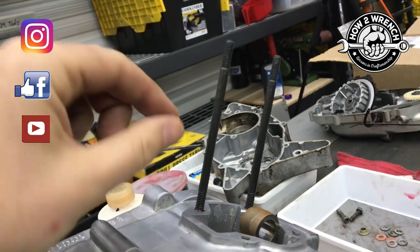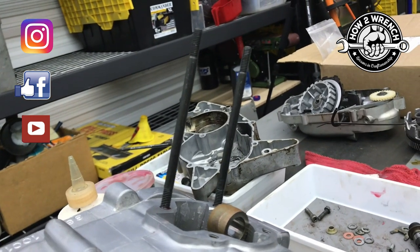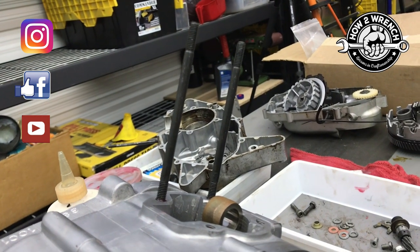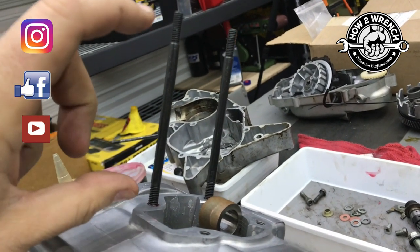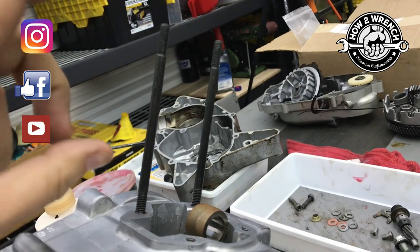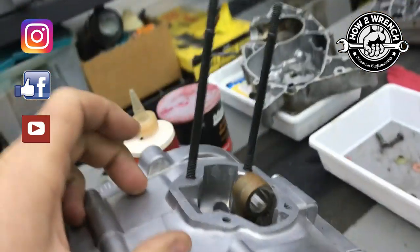When we look at the actual engine and see how long that thin bolt is — and if this thing has had a couple of top ends done to it or been worked on over time — these will stretch, especially when people aren't using torque wrenches. They get super violated, so I'm a big fan of replacing cylinder studs when doing a top end.